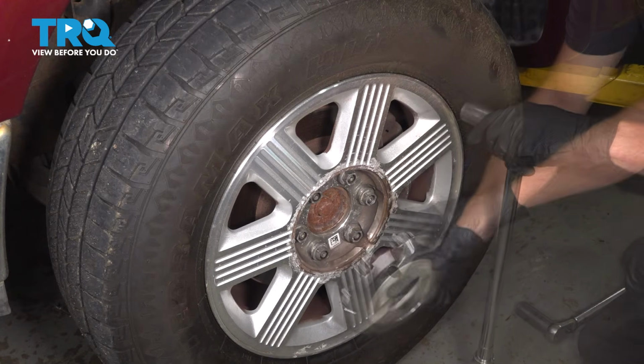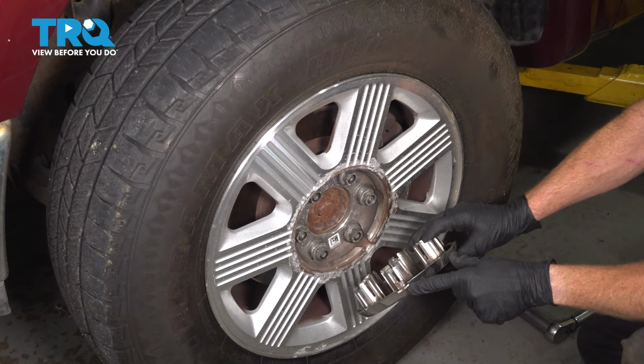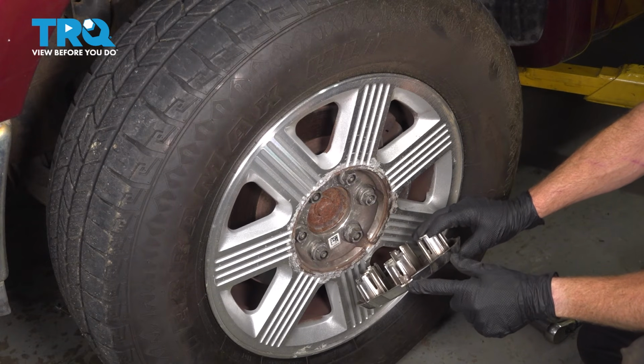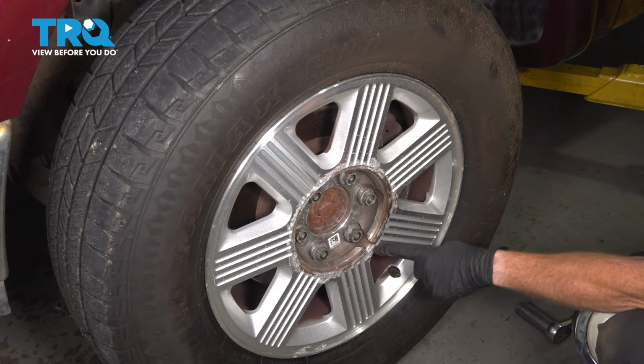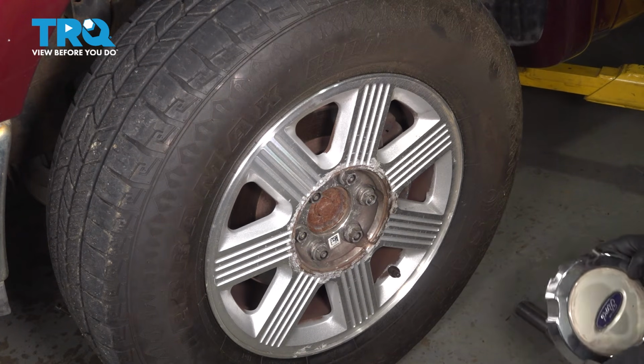Torqued. Now if you have a center cover, let's install that now. For the center cover, there's one area that you want to pay attention to. You're going to find that you have this small prying area. If you were looking at the rim itself, you'll find that you have a notch to align that with. The notch is going to be located closest to your valve stem.